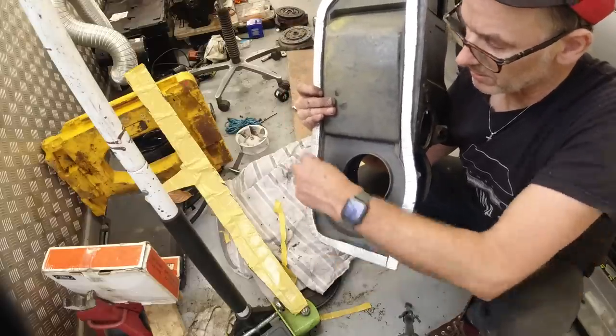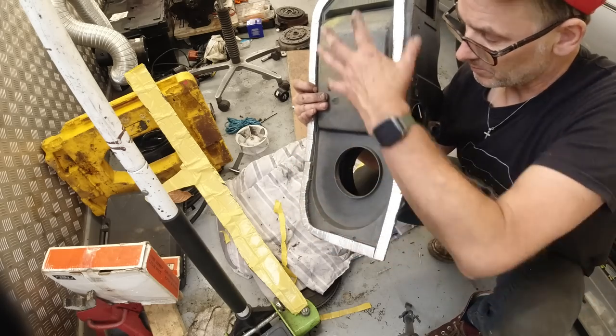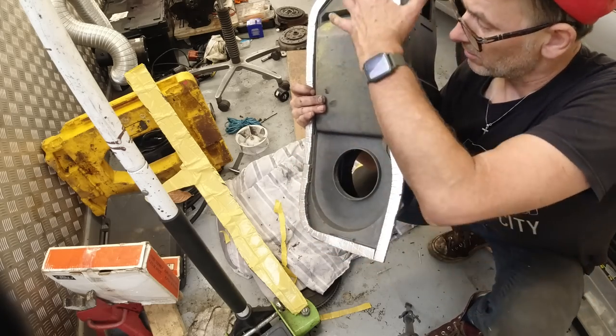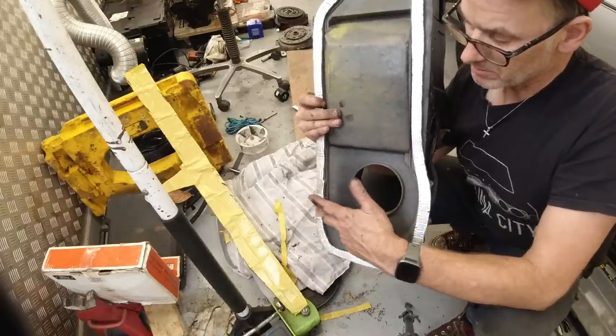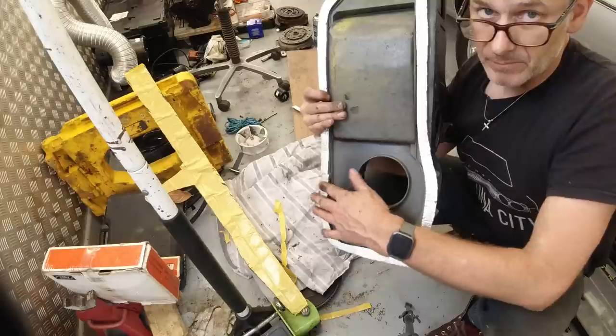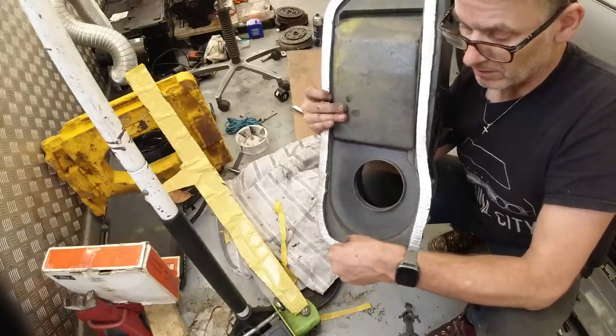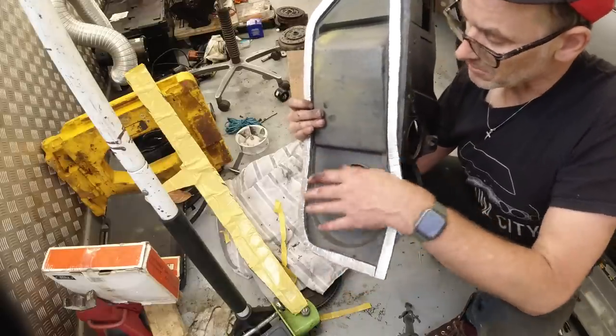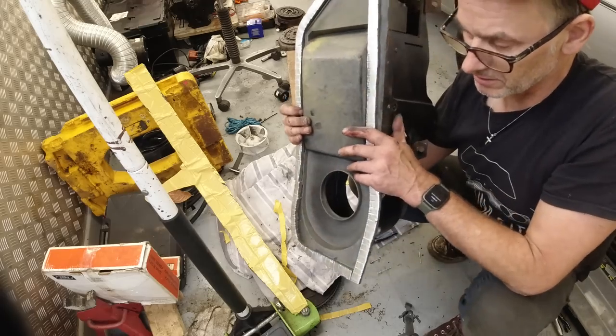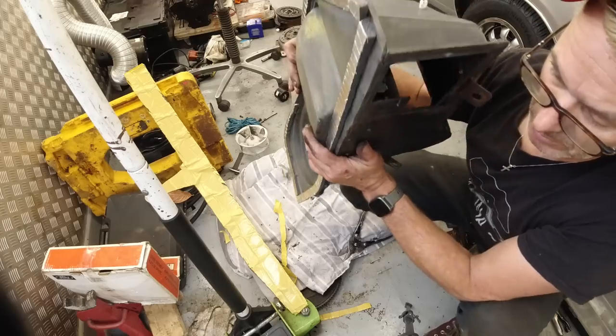I got it from Martrim, cut it in strips. I've put thinners down on a brush and completely degreased this, and it's bone dry, and that helps the self-adhesive foam pad to stick really well. In fact, you can't get it off, it's pretty toughly on, okay? So that makes that airtight seal which you need on that plenum area below the scuttle.